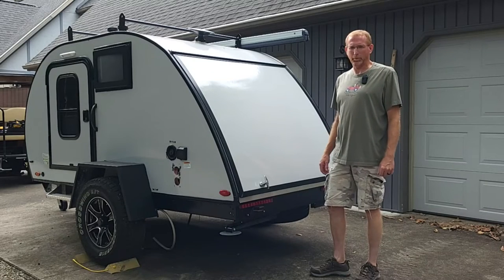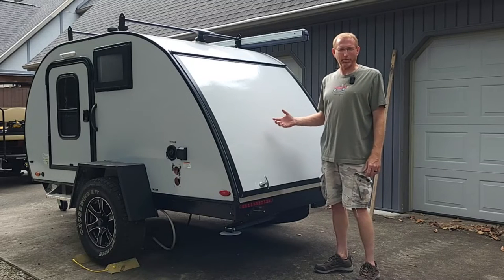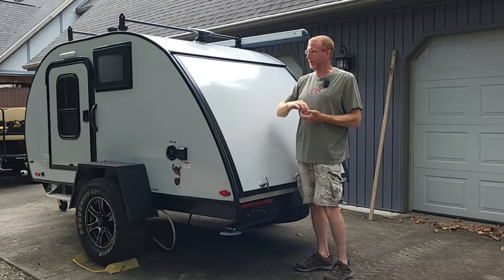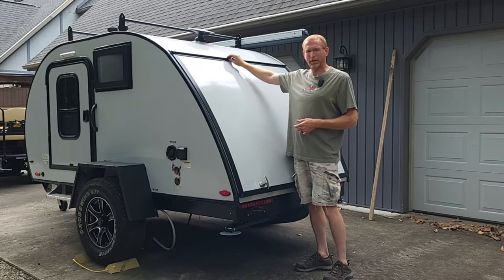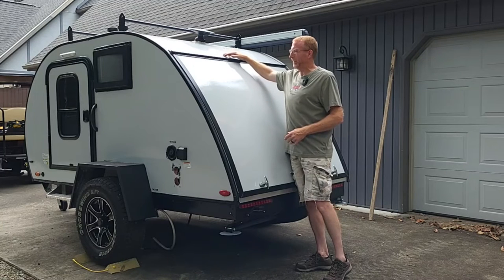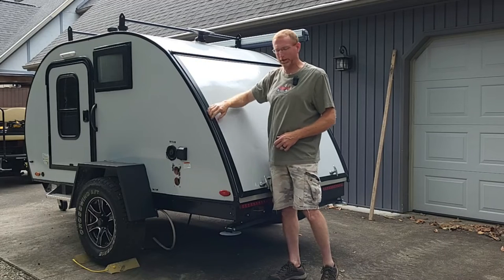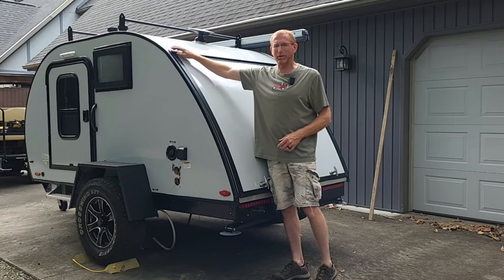Here we are at the back of our Bushwacker 10 HD and like a standard teardrop it's got a large door in the back that covers the kitchen area. Just like most teardrops they utilize what they call a hurricane hinge up here, which is a two-piece hinge that basically creates a gutter channel like your hands folded together. So when it opens up the water that is on top of your door runs down and should collect in this gutter inside of this hinge and run off to whichever side is going to be low. The upper part as the water comes down off your roof it should collect here and either run over top of the upper hinge or in the Braxton Creek case they've got it designed so the water will run around the side and run down these channels and then drain off the camper. The only issue with that is they've kind of blocked their water passage up here at the top and we need to address that as well.